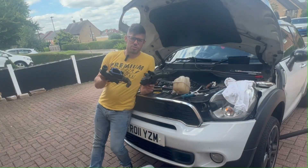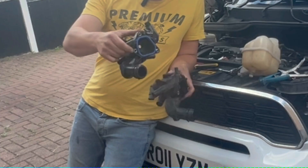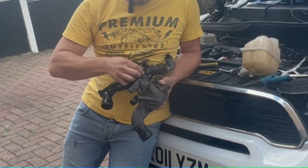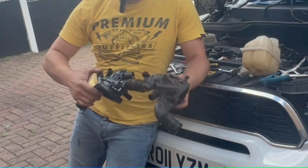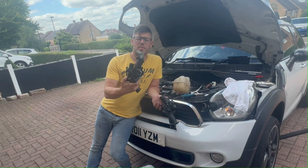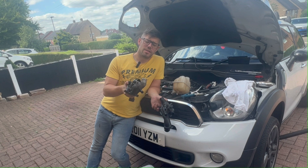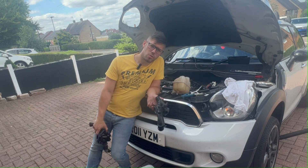That was, as usual, not one of my favourite jobs on this car. There's no real difference between the old and new thermostat except what I mentioned earlier: there's a temperature sensor next to the bleed screw on the old one, whereas on the new one there's only the bleed screw because the temp sensor has moved to the elbow. You will have to refit your elbow and that temp sensor even though it doesn't do anything — just don't plug it in. Getting it back in looks easier than taking it out, thankfully.